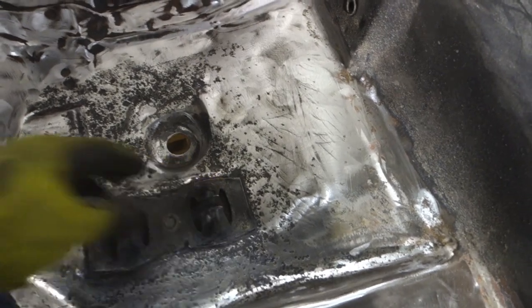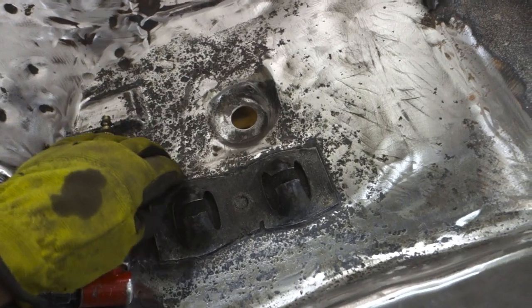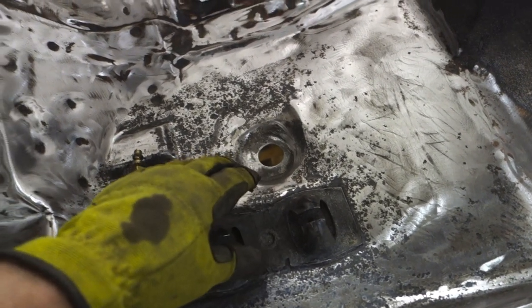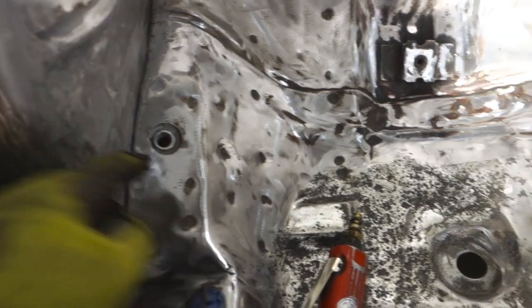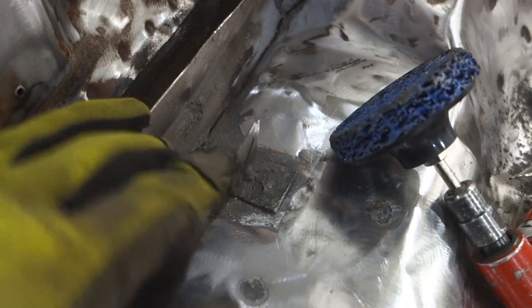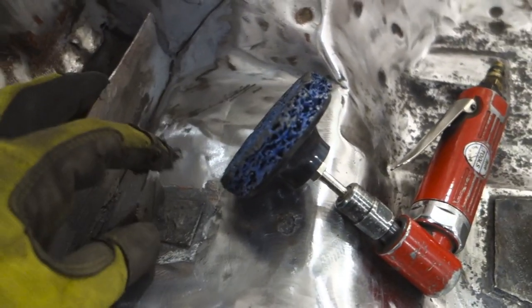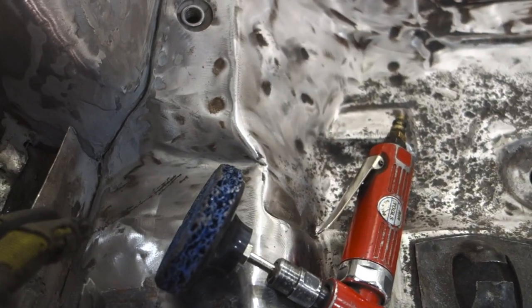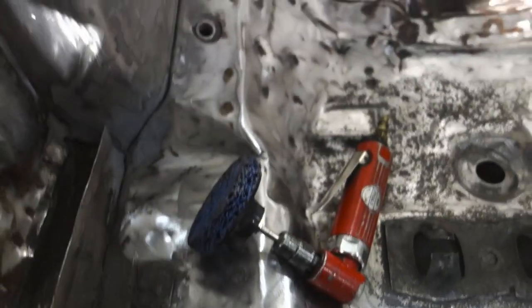I'll have to hit this area with the wire wheel. Now the thing you gotta be careful of with this is you don't want to hit this disc up against metal edges. You know, you get in here and it'll probably cut it up pretty good. When I hit this over here, I could see pieces going a little bit. And same thing, I nicked up against this wire piece here, and you could kind of hear it cutting at it. So stay away from that stuff. Maybe when we get close to the end, we can see how well it holds up to something like this. But for now, I'm going to stay away from any sharp edges and see how far we make it. Again, let's see how far we can make it on one disc.